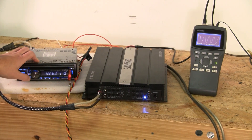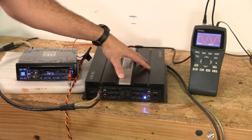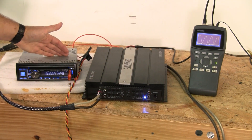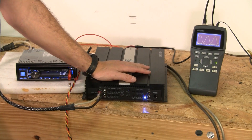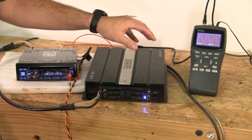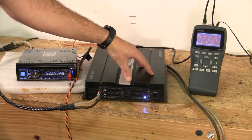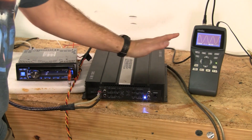So we're going back to zero because that's where we want it set. The ideal scenario is to start with the gain in a very low position. This amplifier takes up to six volts maximum input, and we've only got two volts coming out of the head unit, so the gain all the way down will be nowhere near correct. From that point, listen to the sound quality, adjust your bass, treble, crossovers, and EQ — and then go back and adjust your gains. Run that sweep with all of those settings and make sure you're clean all the way through.